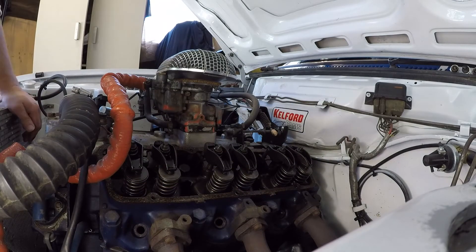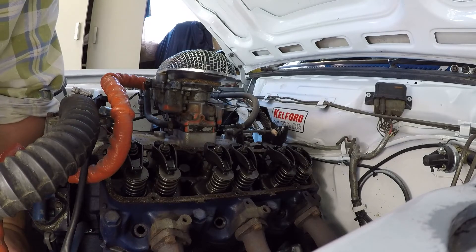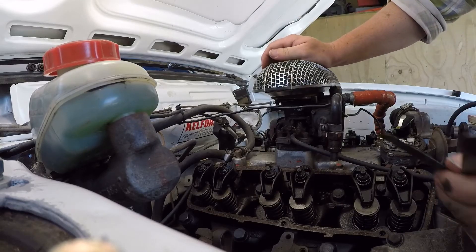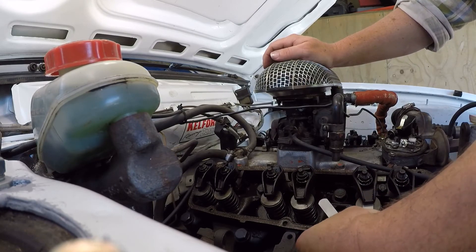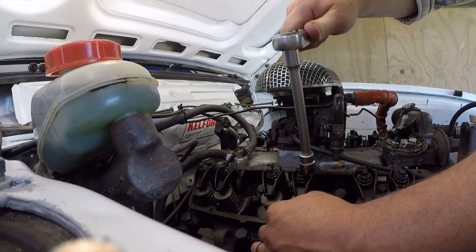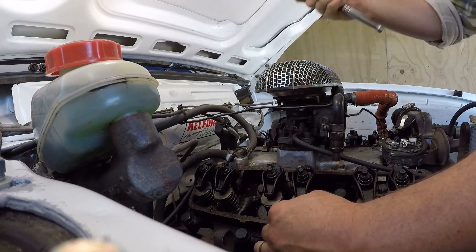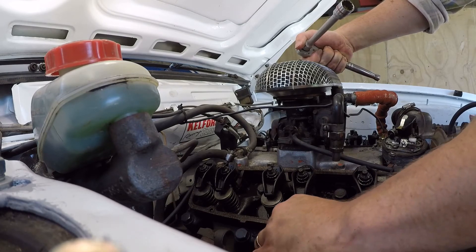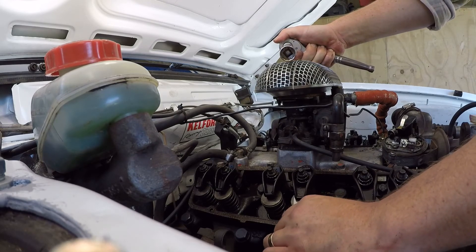So nine and twelve open — that'll be this one and twelve at the back — looking for those two. Now back to the other side of the motor to check two and three, the last two. Two is an inlet so we're looking for 12 thou there — feels good. And three, right next to it, is an exhaust. That's it — all done.